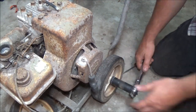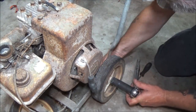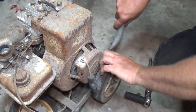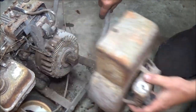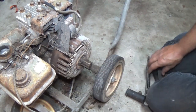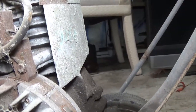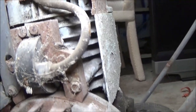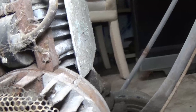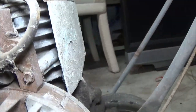Can you guys see that flywheel? Let me take you off the tripod here. See the flywheel? There's the coil, there's the flywheel, there's the magnet. Magnet doesn't look too bad. Let me try to clean this up, see if I can clean that up — maybe get some spark that way.